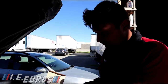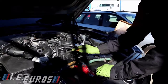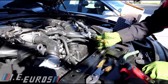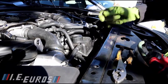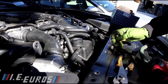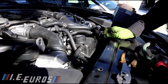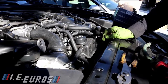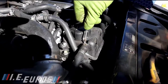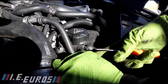We can start the process. The first thing we are going to do is disconnect all these hoses that are connected to this coolant tank because we have to remove it. One important thing before continuing this job: these BMWs from 2010 and up don't have coolant drain plugs — that is very important. So we just leave the clips and then remove the hoses.